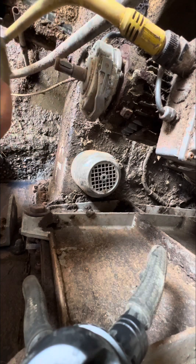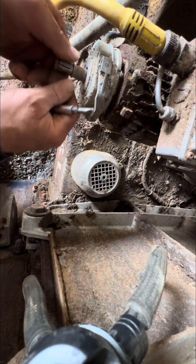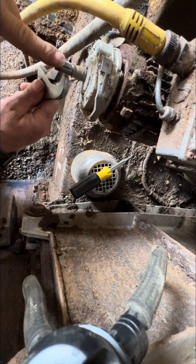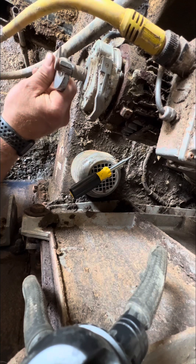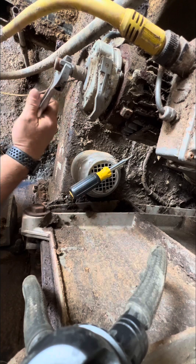I pull the snap ring off, take the fan off, and there's a little key in the shaft. A really cool trick is you take a crescent wrench on that round shaft and try to use that to turn it — you won't screw the shaft up because as it comes around it grabs the key.